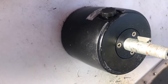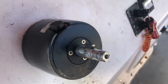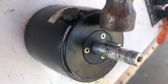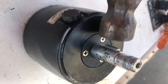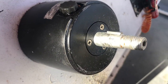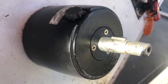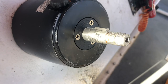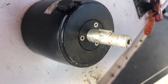Once you get your screws and plate back in, clean out the track that the keyway goes in and wedge it in there — it gives a little resistance. I've oiled everything up and I'm lightly tapping it in place to get the steering back together. There is some salt corrosion in it. It wouldn't hurt to grease the spindle a little bit. This boat's got almost 500 hours on it — we've had it for six months and they get run like crazy. That's one of the reasons it's in as rough a condition as it is.